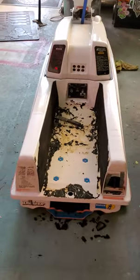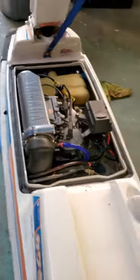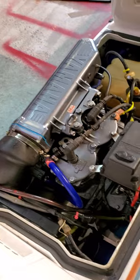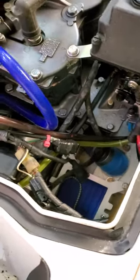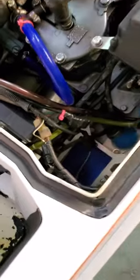So, shit-ass 550 that needs to get gone through — it's got a Yamaha 650 in it. I'll pull off the hood here. This thing has a stock Yamaha 650 shoehorned in, out of a WR3. I had a choke cable rigged up with an old Suzuki RM60 cable I had laying around, fed it through a fuel line, and it pulls the choke. This electrical setup's got to get gone through too — these plugs don't work, it's just finicky as hell.